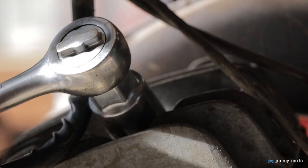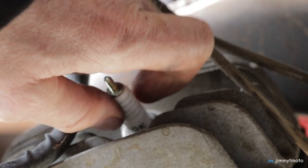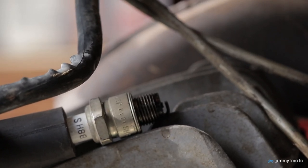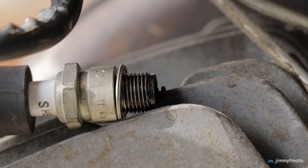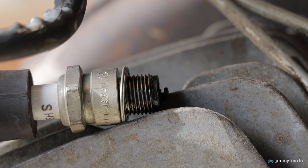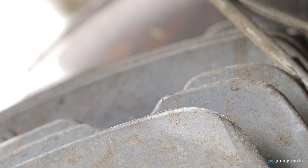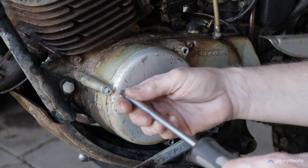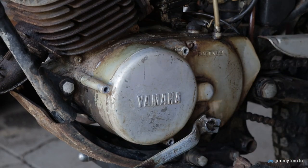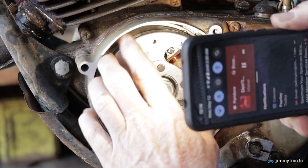With the carb back on the bike, it made sense to go ahead and check the ignition to see if there's a healthy spark at the spark plug. With the plug out and resting on the cylinder head, giving it a few kicks, the spark appeared intermittent and weak — a small red spark instead of the healthy blue-white spark we'd like to see — which means it's on to the flywheel and points system.